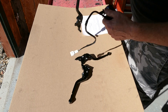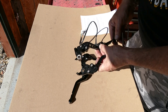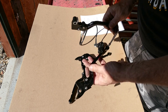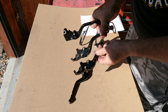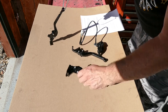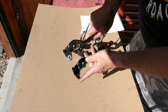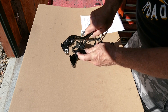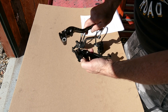It's a popular misconception — I've had two Royal Enfield dealers say they just supply the Himalaya ones. But the front brake lever does fit: as you can see there's no difference on the front brake one. You can see quite clearly the differences on the clutch one. The shape here is different, the centres are slightly different, but most importantly it's this little cam here that contacts on the switch.